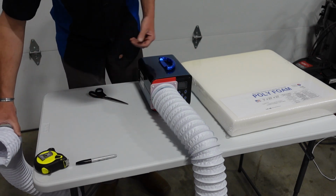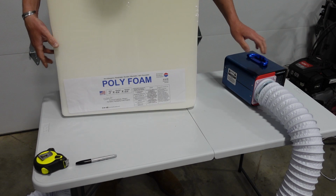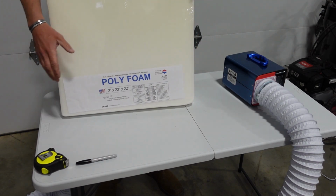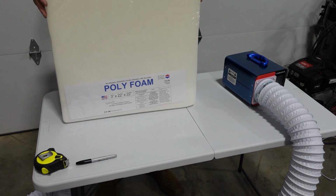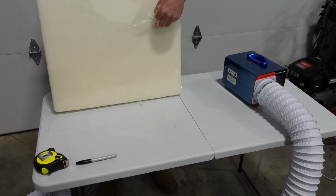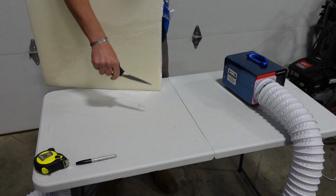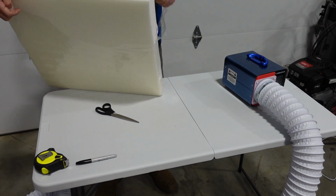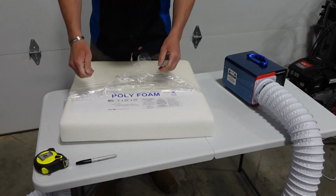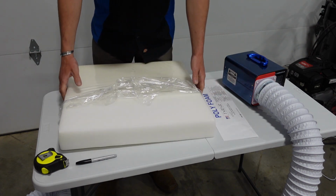And since we want our window to compress our foam, we have to leave ourselves enough room so the window can squeeze down on the foam without crushing our tube, which is 4 1/4. Now if you guys find foam anywhere cheaper, a better source like a square roll, please let me know. Drop a comment below and I'll definitely let everyone else know where they can find it. It's something that's pretty odd. This is sold as being replacement foam for a seat cushion.